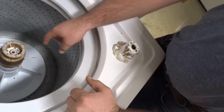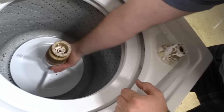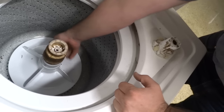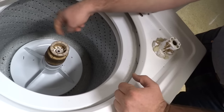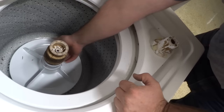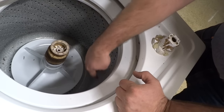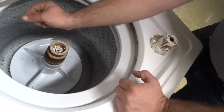And that should help you grab the right way. Now, if you're in here looking and you notice the agitator was not holding very well to the spindle, you can lift this whole piece out. There are also some tines on the inside — if those are worn out, that'll be the cause for the entire piece not moving correctly. There could be things underneath, but you can always pull this out and check to see if those are smooth.